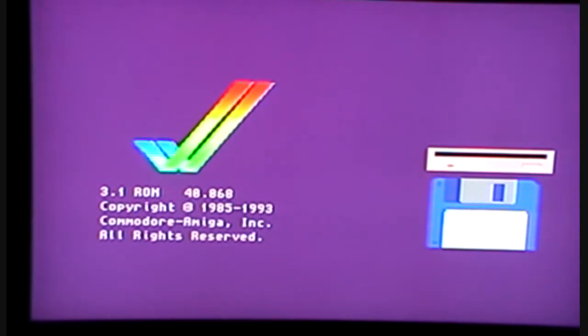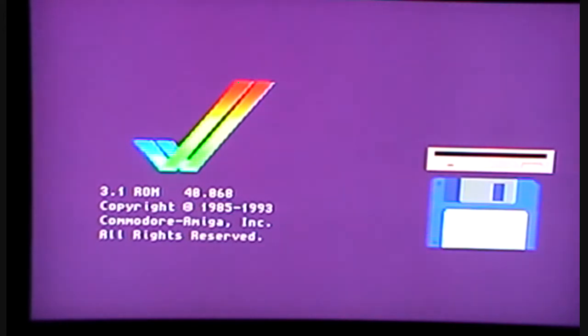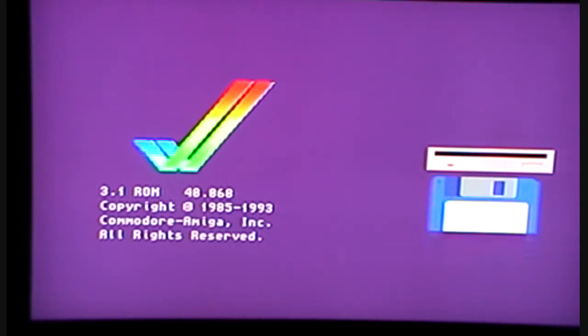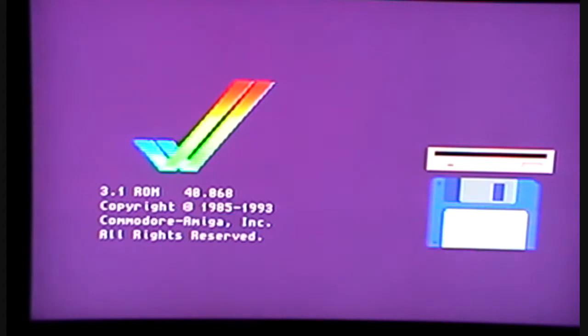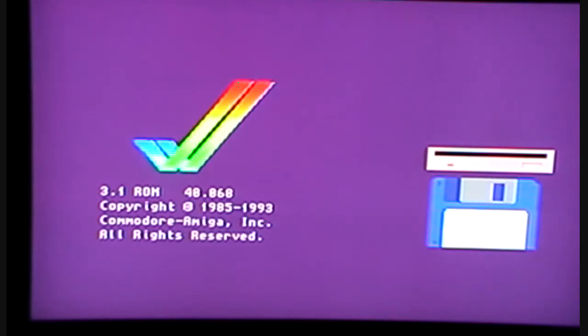The reason for the delay is because back in those days, in '93, '94, that sort of era, some hard drives were very slow in spinning up to full speed. So what the Amiga operating system did, it had like a 30-second delay to allow the hard drive to spin up, because what would happen is the hard drive wouldn't spin up fast enough from a cold boot, and then it would go to this screen rather than booting off the hard drive. So that's why you had that long delay.